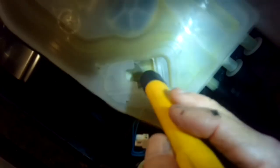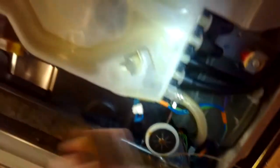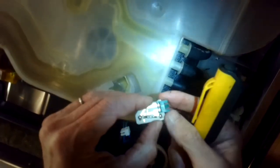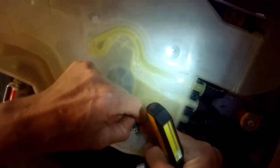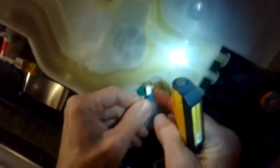Check the wheel using a magnet and make sure this little paddle wheel can move really easily. If it moves easily and there's still a flow sensor problem, these parts are pretty cheap — just replace it and it'll fit in like that. Push it in and it'll click into place. Put the power connector back in; when this goes back in, the open area of the green piece is facing you and the little tab is away from you. Push it back in and click it in.